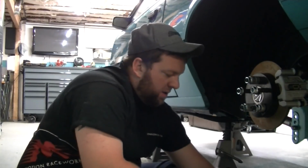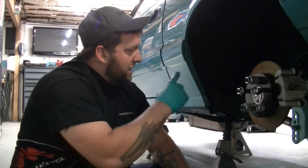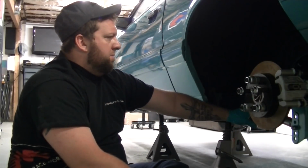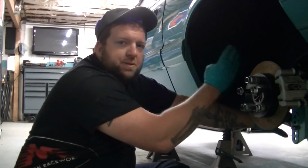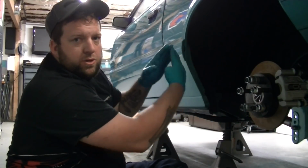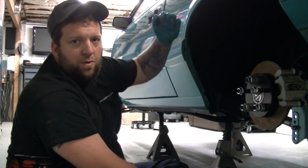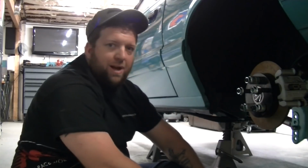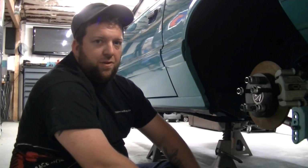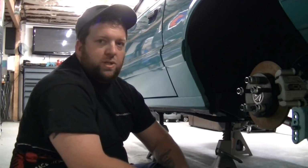So there are a ton of calculators online to do your anti-squat length and height. It's just all measuring your control arms. And you want to measure your control arms parallel to the axle. So you know your control arms are angled, right? You got your control arms angled, but you want to take like a carpenter's square and measure straight out and over to that bolt. That'll give you your actual measurements. You don't want to be off 1/8 of an inch. You can be off 4 inches up front, and if you're trying to plot a suspension, that's a lot.